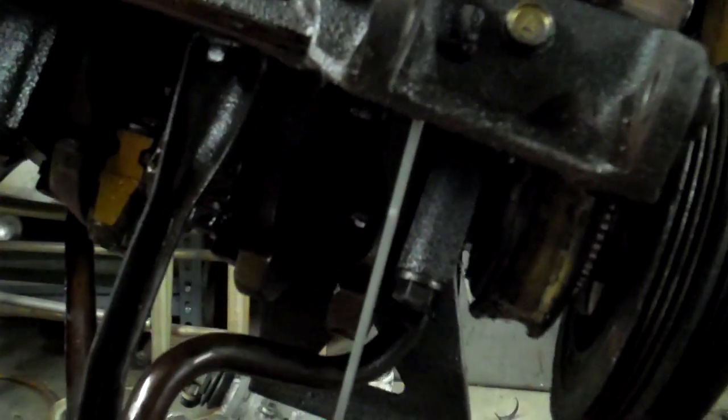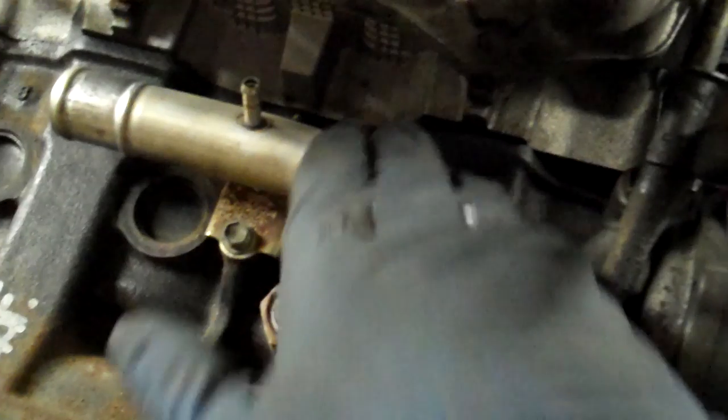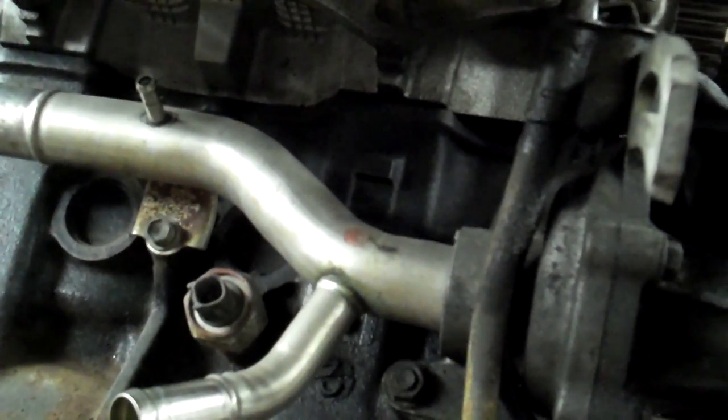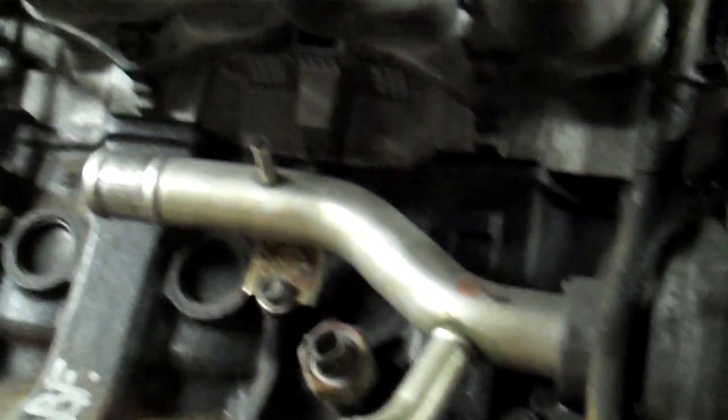The reason why it's so much work and why I'm doing a motor swap is that you have to load the pistons and the new connecting rod from the top. And to do that you have to take off the cylinder head. This is the cylinder head up here, this is the block — you can see the difference in color. This is a cast iron block and that's an aluminum cylinder head. The reason you have to do them from the top is the piston rings. The pistons are round and they've got rings on the top. You have to hold in the rings while you load it down into the cylinder — there's no way to load the piston rings up into there. It's just not possible the way the engine's designed. Anyway, that's rod knock.